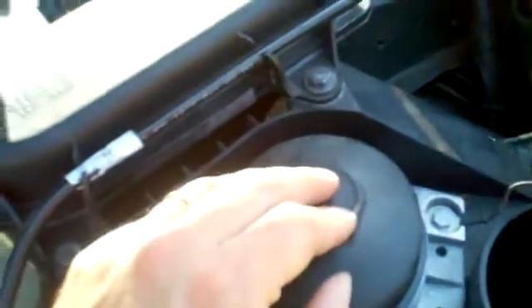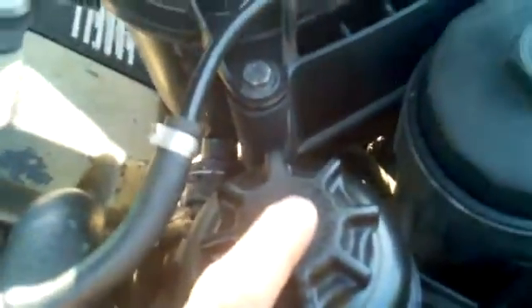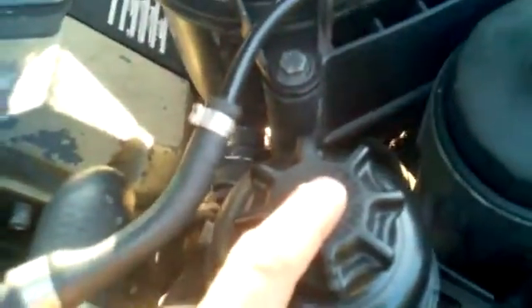Here's the oil filter cover; the oil filter is right under there. You do have a ground over here — sometimes the mounts actually break and you have to replace them, but there's easy access to the oil filter. Power steering fluid always seems to have this star pattern cap, and this takes ATF — you don't want to use power steering fluid, you want to use automatic transmission fluid. Any Dexron transmission fluid would be good.